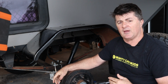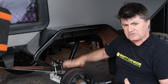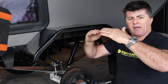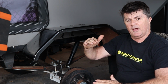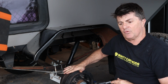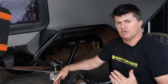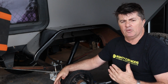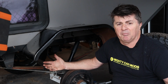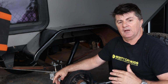with the top of that hanger, and what it does mean is that if pressure comes off a tyre because of road conditions, the whole back of the spring will move down and then clang back up when pressure comes back onto these. They're mainly suited for tar road use. I wouldn't like to be using them constantly on dirt roads, but they'd probably be okay. But it's just not a very elegant solution.